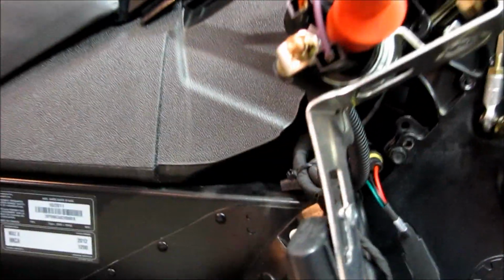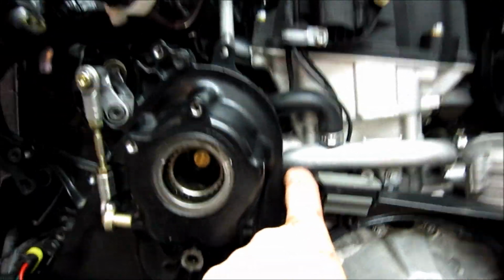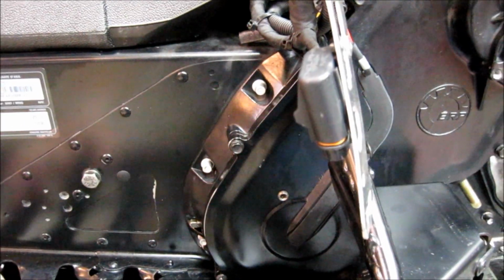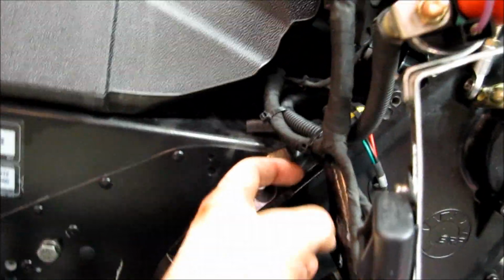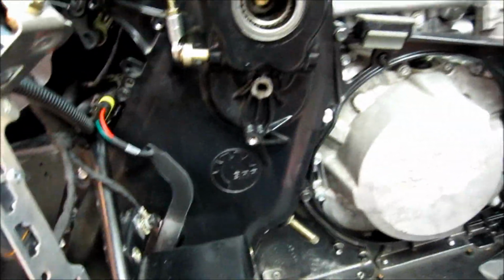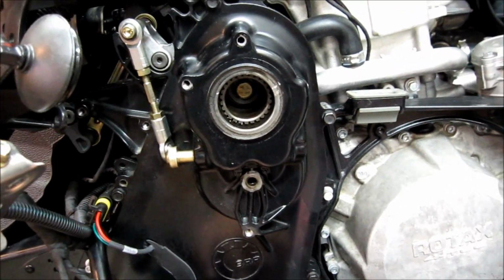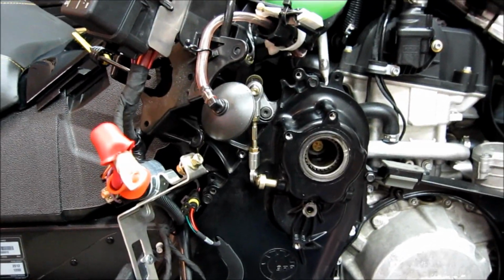Okay, next step is to put in your 7 black chain case screws. There's 7 of them, they're all the same length. You want to put them all in so they touch the cover, and then gently go crisscross pattern, and you're basically closing up the gap of the cover. You want to keep it even. I've never stripped these. People do strip them. It doesn't take a lot of torque, and all this stuff bends very easy. You have some alignment pins, make sure that those are aligned good. You can easily with your hands close this gap up quite a bit, and then you want to go around crisscross with a wrench, snugging them up gently to close this gap up before you do the final torque on them. Take a minute and get all 7 of them snugged up evenly, so that closes that gap up.